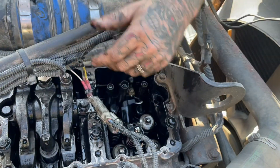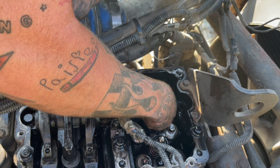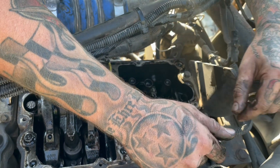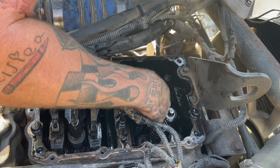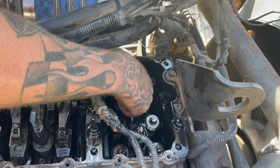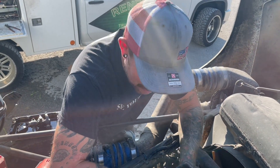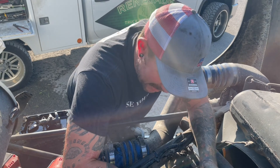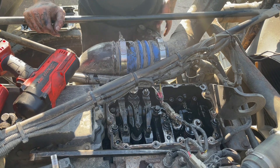Get that out of the way. You've got your two valve spring pedestals right here — go ahead and pull them off and get them out of the way. Then you want to go ahead and unplug your injector — sometimes it can be a monster, or sometimes you can wait until you get the injector loose. Go ahead and check your push rods and make sure they're fine — nothing's wrong with those. I like to leave them in. There are cups down in the bottom — you want to leave them in the cup, and when you put this thing back together make sure they're in the cup.